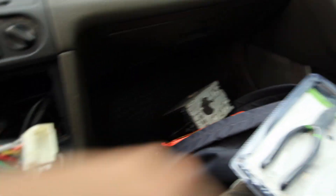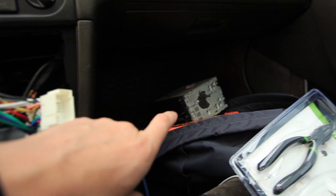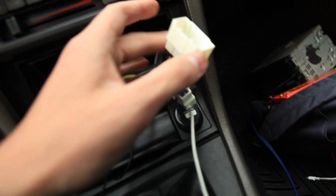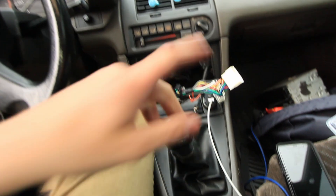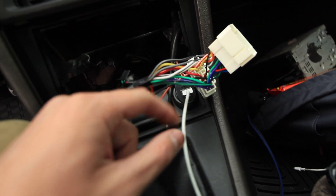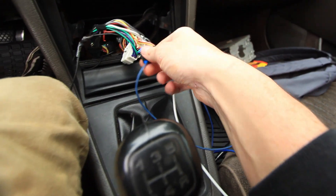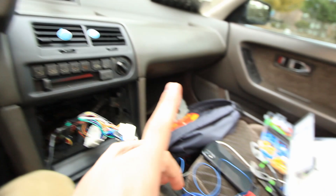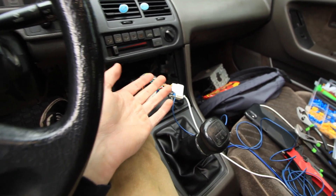Just to keep you guys in the loop, I ended up unplugging the radio entirely and I'm pissed at myself for not just buying the nice Apple CarPlay radio from Walmart. I'm going to take the red signal wire that tells key-on power, splice in my small blue one, splice it into the red one right there, and then splice it into the sub in the back. That'll basically make it so the sub's not always on — it'll turn off with key power. I spliced it into that extra piece of wire using a male and female connector — it's not perfect but I have some electrical tape around it. Making progress.